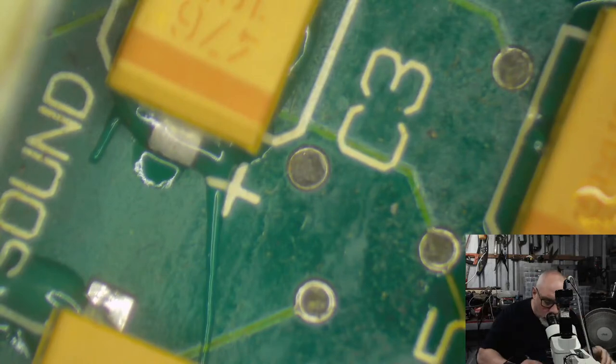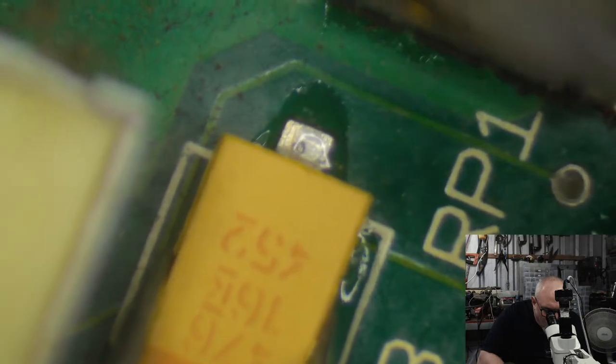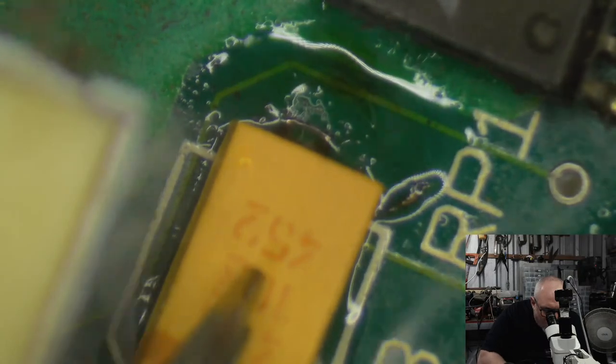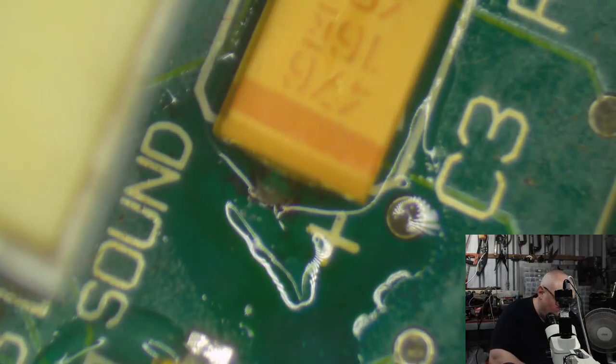If you wanted to do something a little bit adventurous and you don't want to use tantalum, it costs a little bit more, but one of the really good things you can do is use a polymer hybrid electrolytic capacitor. They look essentially like a surface mount electrolytic capacitor, that little aluminium barrel with the black on the bottom. But instead of using a liquid electrolyte, they use a powdered polymer, so they don't leak, and they last a really long time. They're quite expensive, though. They are a good alternative because they do last a very long time, and they're good quality, but the downside is they are very expensive.